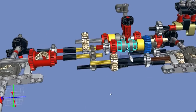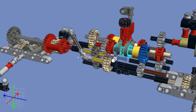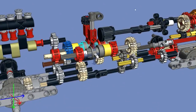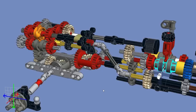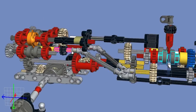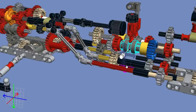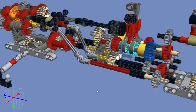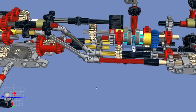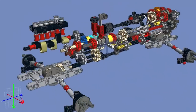After the high-low selector, here's the axle that is the input shaft for the gearbox. The orientation of the universal joints is very important — more about this later. Here's the 4-speed gearbox at the rear of the car. There are 4 gears selected with this knob — they make this output shaft slower or faster depending on the gear selected. The last step is the axle that connects the output shaft from the gearbox with the engine, again through a series of gears. There are actually more gears built in than the Bugatti Chiron.